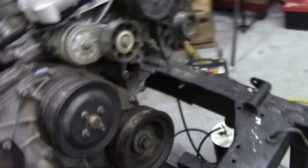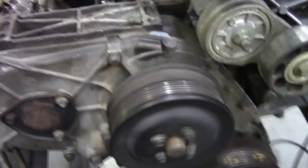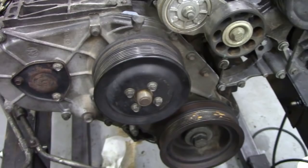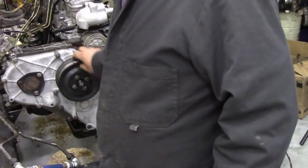Later, the other thing I'm going to change while it's on the stand is this bearing here — listen to it. I can't let it go like that. I put it back on but I have another timing cover already made up, because I changed that bearing when we did the timing cover previously, so I'm going to put that on. I've got the new cover on and that's a lot better. I couldn't let it go like that.